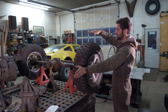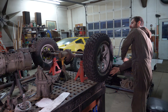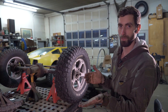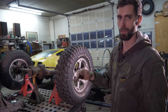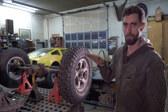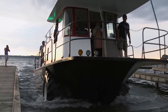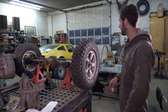It's going to be a teardrop-shaped fender, and the plan is to be able to pivot it right in the center so we can flip it. The teardrop will be this way and it will act as a ski. The biggest thing about amphibious vehicles — and all boats really — is getting onto the surface of the water. You have to be like the opposite of a wing; you have to push yourself out of the water. When you have enough propulsion you start to skip on the surface, and that cuts down on drag tremendously. The houseboat wheels are just dragging and you max out at about 10 miles an hour doing that. But this one I'm hoping to go faster, so that's the plan with keeping the wheels above the surface of the water. Whether that works or not — that's the prototyping, we don't know.